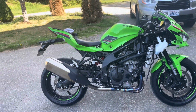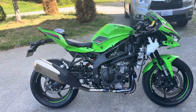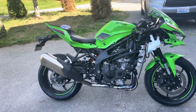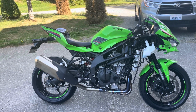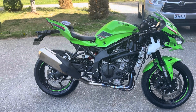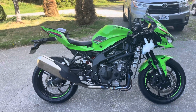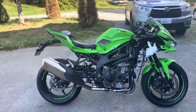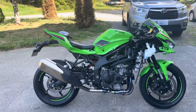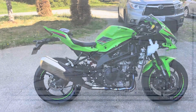talking, and it's like, well, if it works for the Graves catback, it should work for the stock muffler, which it did. Some of you, I'm sure this is of zero interest to, but I'm sure there's a lot of you that go to tracks where they do sound decibel readings, or are older like me and just don't want to make a bunch of noise, or you just want to be kind to your neighbors or whatever. And this is definitely a viable setup. It's got the heaviness of the can, which would be nice if it was a little lighter, but the sound levels are identical to what I tested on the stock bike with my decibel reader. And as you'll see, the dyno runs are quite impressive.